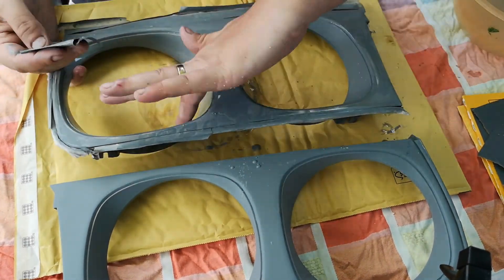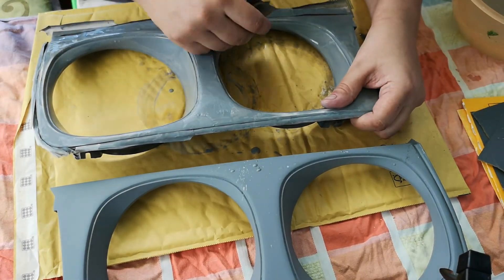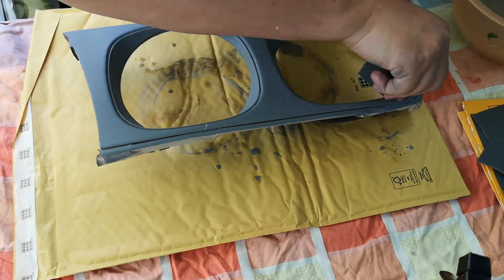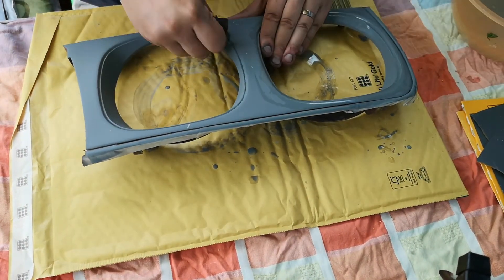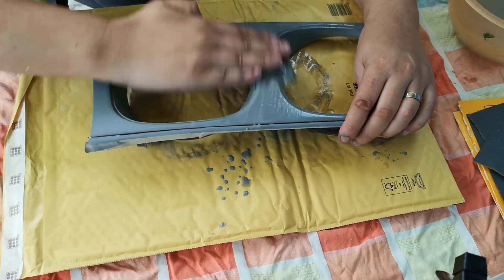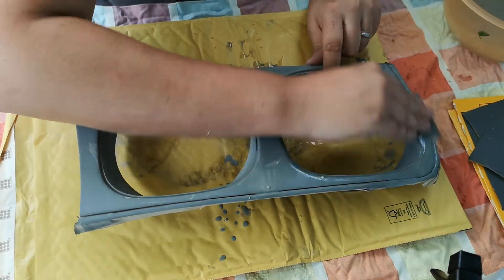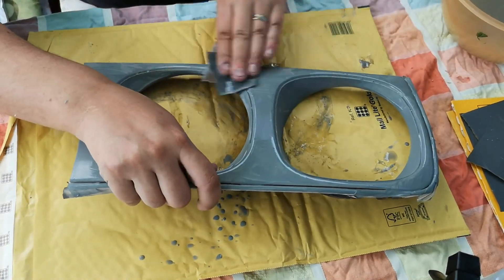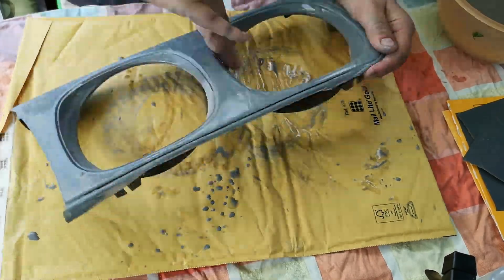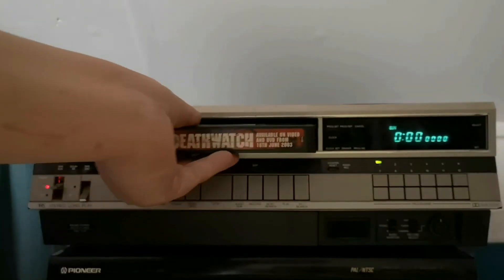In total I applied two coats of primer and two coats of top coat, which will be coming in the next video, and then one coat of clear coat lacquer. Make sure you get into all of the nooks and crannies - where you've got the little indent at the top, make sure you get in there to remove any paint that may have got stuck between coats. I found that folding up a bit of wet and dry and almost scraping it in like a scraper worked quite effectively on those particular areas.